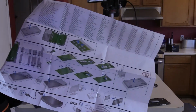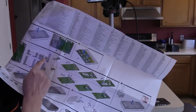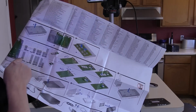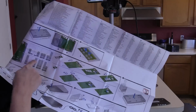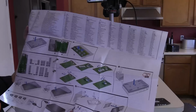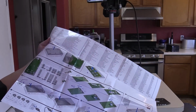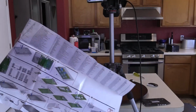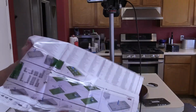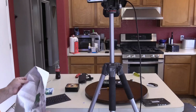So we're only going to use one M280, so we're going to use one of these long sticks. You look at the photograph to see one that has one long stick on it, and it says you can put it in A or B. It shows that if that's your configuration, this one here or this one here, either way is acceptable. It doesn't really give me any performance numbers with regards to the speed of those slots. I assume they're both PCIe 3.0 by 4, which is what NVMe basically means, for those of you who speak that language. So when I look at the NUC, it looks like I can't get it wrong.